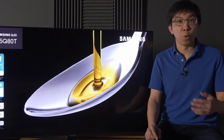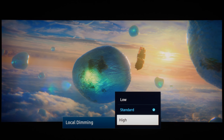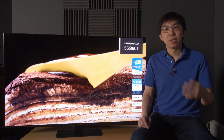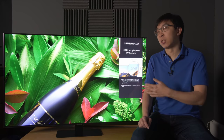The good news is that Samsung has provided a way for dynamic tone mapping to be disabled this year for more accurate reproduction of creative intent. Looking at this paused frame from Pan, the default local dimming setting of standard would apply some dynamic tone mapping, but switching to high would disable dynamic tone mapping, thus retaining more detail of the sun and surrounding clouds, with the APL looking closer to reference. Even if you choose to engage dynamic tone mapping, this year's algorithm is far less aggressive compared with last year's undefeatable implementation. In terms of dynamic metadata format, Samsung continues to support only HDR10+, but not Dolby Vision on 2020 models such as the Q80T.